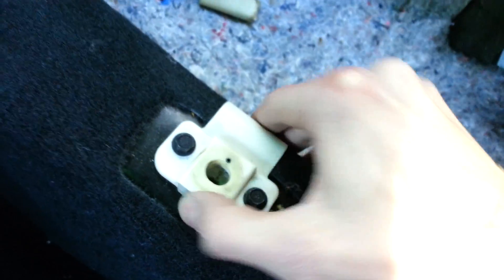To take out the back seat, all you got to do is reach underneath there and push this little tab right there — that's all you got to do. That releases the whole back seat. Just push the seat belt buckles down.